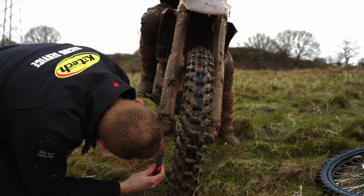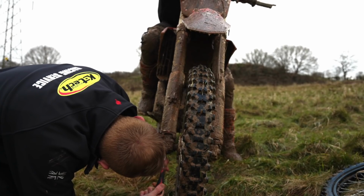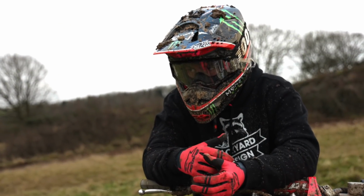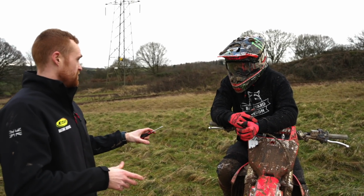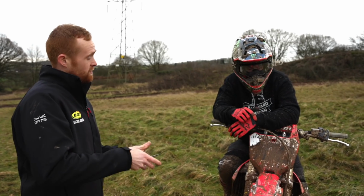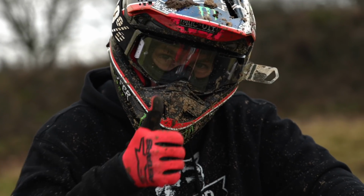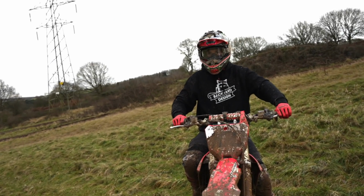So what are you doing now, making it faster? Yeah, again, just okay, so if I say I want it faster, that's the high speed? That's the rebound. Rebound is making it quicker. High speed is mostly, you'll only have a high speed adjuster on the shock. Oh, okay, yeah. And that's what gives you the supported feel, or less support depending. So we've made the rebound faster. That's it, yeah.